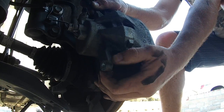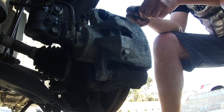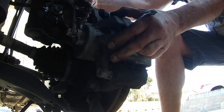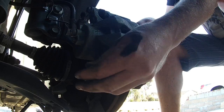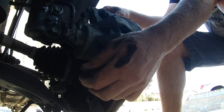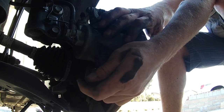Do you turn the rotors at the dealership? Yep, turn the rotors or replace them, depending on the condition and thickness of the rotors. This is the first brake job this car has ever had, so I'm confident the rotors are still thick enough — 56,000 miles. It hasn't gone to metal, so they're not super grooved or anything. They should be fine.